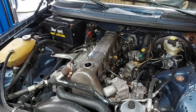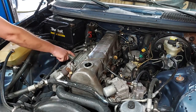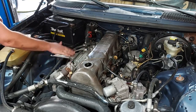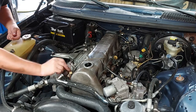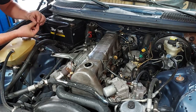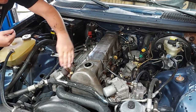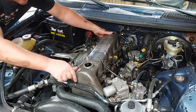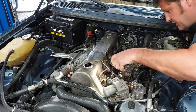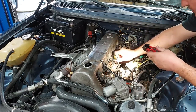Let's go ahead, finish our valve adjustment, get a new valve cover gasket, and get this back on the car. Now we just need to put our nuts back on there. You can see the previous owner already changed the air cleaner housing mounting bracket and put new bushings in there — that's brand new. These 13-millimeter nuts just go around here, and guys, you don't torque these nuts down tight. It's only like 10 foot-pounds or so. When you put it back on, check your valve cover gasket to make sure it didn't fold or twist under as you were putting it together. Always get a flashlight and go around, especially in the back corners — you want to make sure it doesn't fold under because that will be an immediate oil leak.